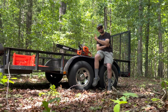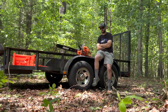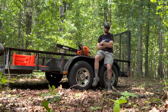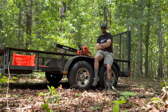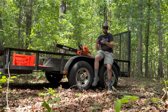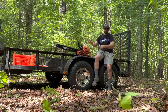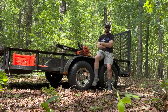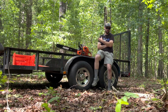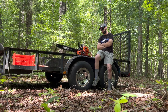There's two different style 600Ps. We'll get into that in a minute, on into the video. This is the later 600. This is very equivalent to the 590. The piston and cylinder and the carburetor are the same as the 590. The 620P has a bigger cylinder and it has a different carburetor and coil as well, compared to the 600.